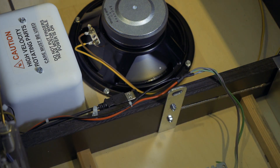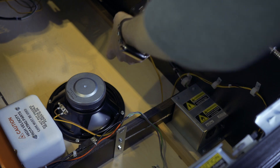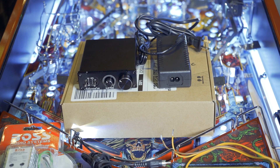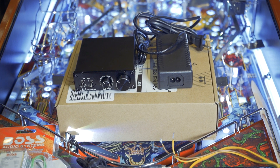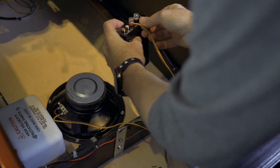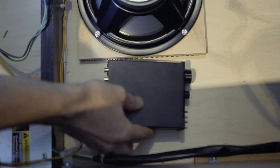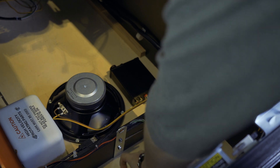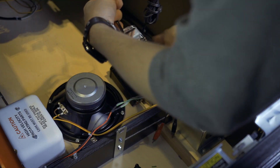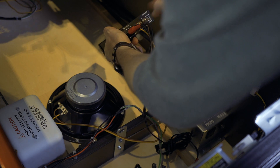The rest is fairly easy — we're just going to plug everything into the amplifier. For the last thing, we're going to hook up our speaker terminals to the back of the amp. I've included links in the description below for the amp and the line level converter — using those Amazon affiliate links helps out the channel. Put the positive to the positive terminal and the negative to the negative, and just screw them down. Next, grab your RCA cable and plug it in — red to right and black to left, though it doesn't really matter since we're running in mono anyway.